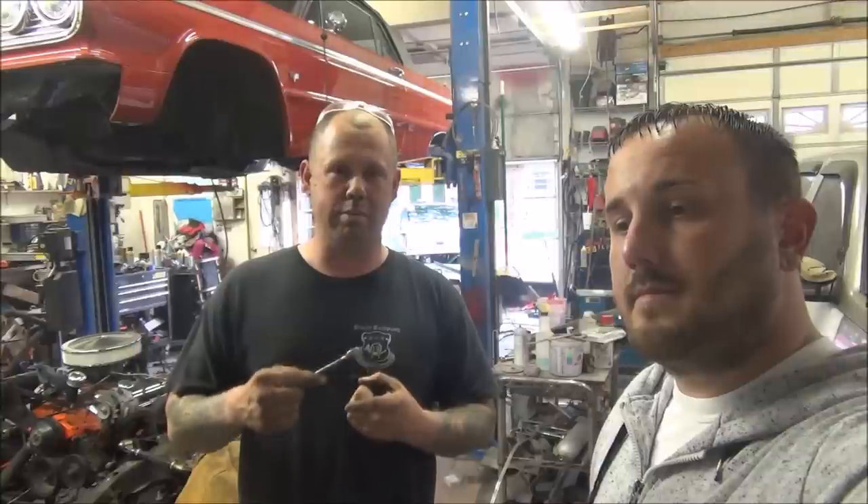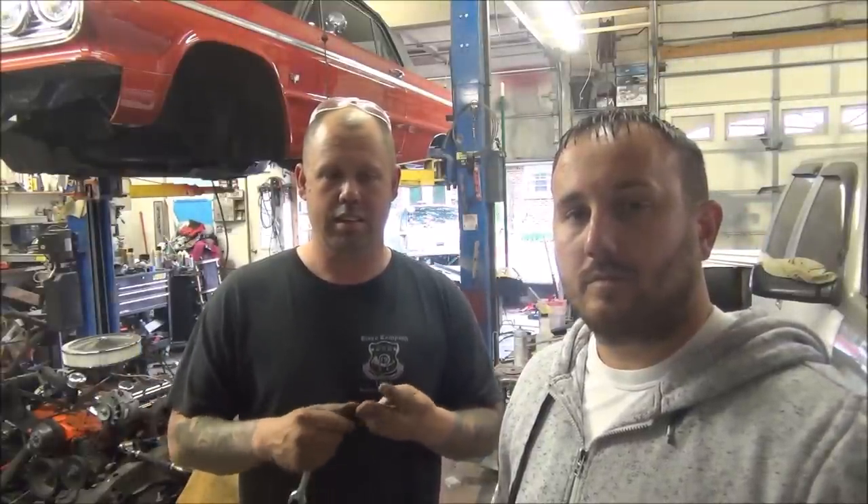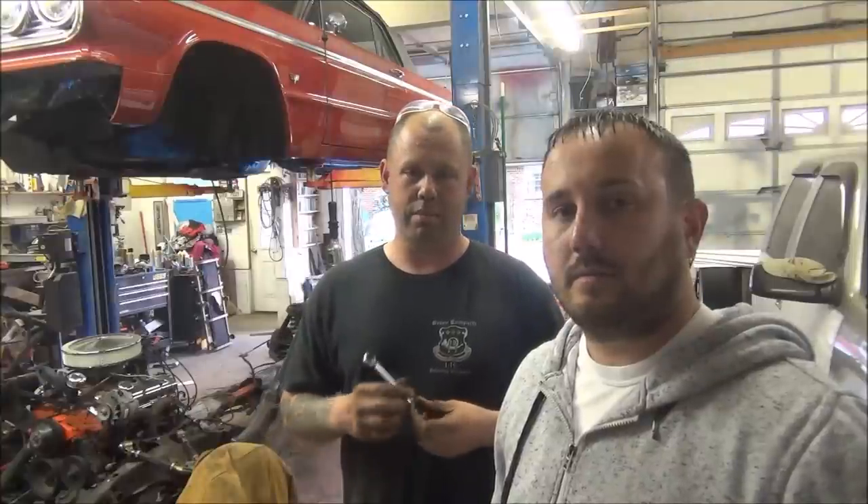On a convertible especially, there are 8 body mounts that have to be taken off, and that's just a start. You've got to take apart the transmission lines that go to the radiator, the heater lines that go throughout the engine, there's the drive cable that connects the speedometer to the engine, and a whole myriad of other things. A lot of people actually try to take off the front end of the car as well — the fenders, the hood, stuff like that. We actually managed to avoid doing that, which saved us a lot of time, just by being very meticulous and taking apart the different wirings that go to the headlights and things like that.